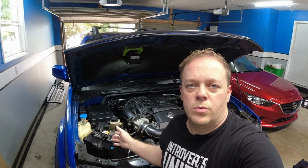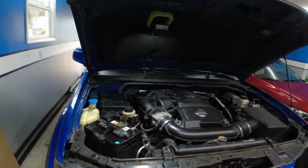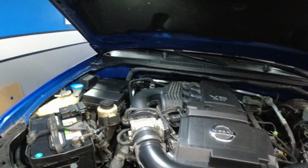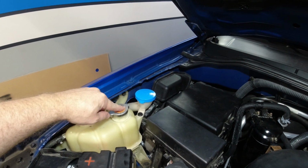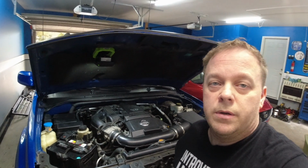The last thing that I ended up doing was make sure that the coolant that I had removed was put back, and so all that I did was fill up the radiator and then also fill up above the full mark by about 1 inch. And then I pretty much took it out and I drove it.